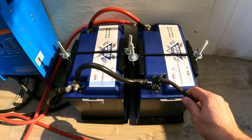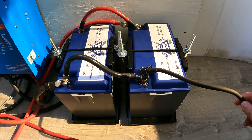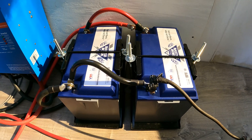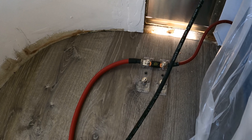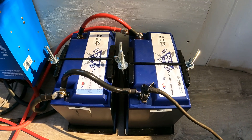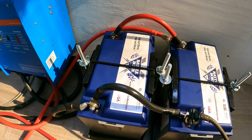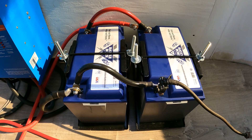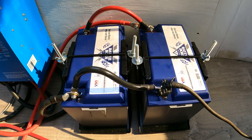This negative black cable from our previous house batteries is bolted on in a makeshift fashion — it's only six or four gauge cable. There's not a lot of current on the DC side; it's mostly just lighting, water pump, and a couple of other devices. We also have a fuse protecting the entire DC side of the system so those circuits don't draw more than the cabling can handle. Our battery holders, main disconnect switch, and main battery fuse are all sort of cobbled together — proper parts are on order. Welcome to the post-pandemic ordering world. We made it safe and used what we could, but we need to get on the road.